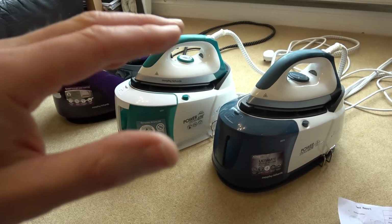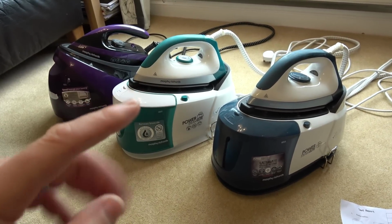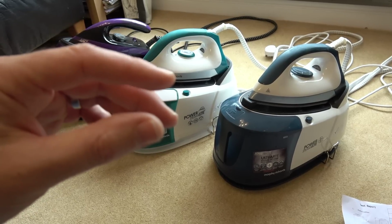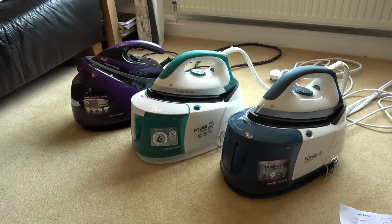Or is it because it's sat on top of a boiler and all that heat is just getting trapped in there? The thing is, it's a wire covered in resin. Why is it failing? I can understand if the coils were shorting together. They're not. They're testing open circuit. Why is it breaking there? So a real strange one to me.